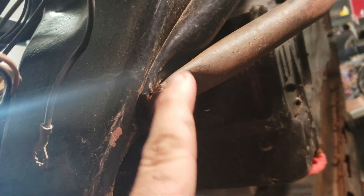For the rear of the car, we have the G-body UMI suspension rear shock tower brace. It mounts right above the bolts for your shocks. The next one is more for coupes and sedans — it won't work for wagons or El Caminos. This rear brace is really preferred for t-top guys, because with high horsepower you start cracking the rear roof line. You may start seeing cracks right here and in other spots — that's because of the roof line tweaking.